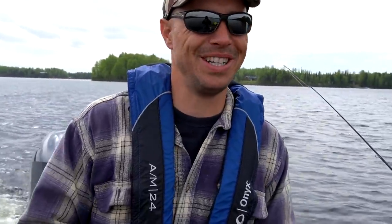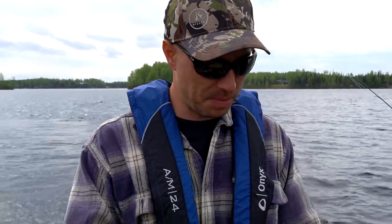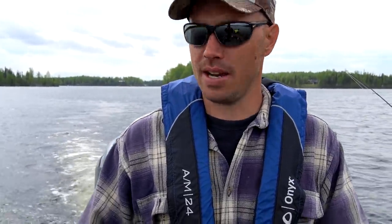The boat's running good. This motor — I cannot believe how smooth and quiet it is. We're used to our old little two-stroke one, so this is really nice. Per the manual, we're going to keep the RPMs under 2,000, back it down, go up again, back it down. We're supposed to do that for about an hour, so we'll just cruise the lake. It's not too bad out here.